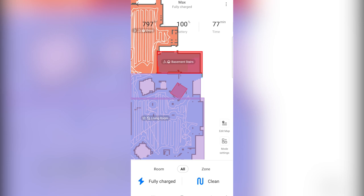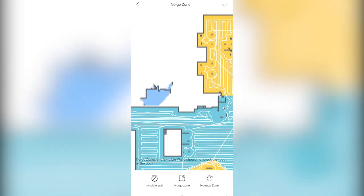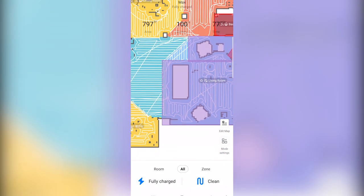The next thing to show you is no-go zones. I've got a section called 'basement stairs' — that red box around there is a no-go zone, meaning the robot will completely avoid that area, as you can tell by the path lines. The white lines are the path the robot has taken to clean, and the big white boxes are furniture it has mapped out using the on-board LiDAR. The red square inside the living room is a chair the robot can get under but will get caught on or scratched by a loose spring at the bottom. To add a no-go zone, hit edit map, then no-go zone, zoom into the area, and it drops a square box. You can rotate it sideways if you need to box out an angled area. I added a no-go zone for my pantry — so now even if that door gets left open, the robot will not go in there.